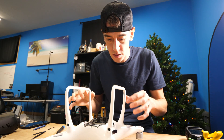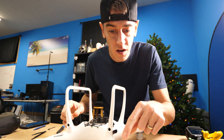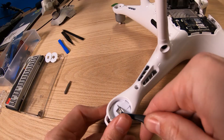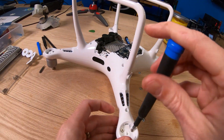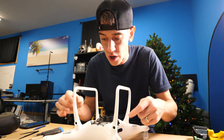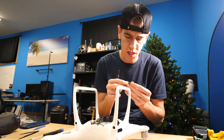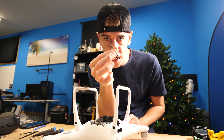The next step is going to be taking apart the lower shell. You don't have to take the legs apart — you're just going to take the entire lower shell off. To do that, we're going to have to take off all the bolts all the way around, and there are some underneath these little flaps, which you can easily take off with a pair of tweezers. The four screws closer to the body, near the center of the drone, are pretty deep in there. The size we're using for these bolts is a 2.0 millimeter hex. I'm just going to use an angled hex key to get those ones out.